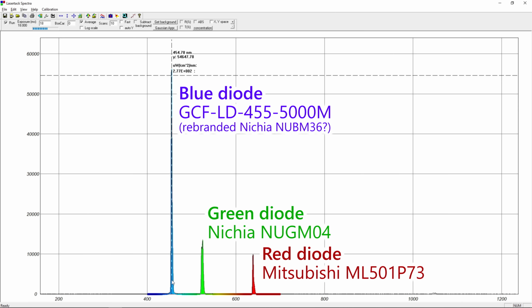But since I have no idea of how to, and could break it, I will first test the laser's wavelengths. The blue is 455 nanometers. Nice! Bluer and 26% brighter than a more indigo 445 nanometers of same power. Green is 525 nanometers and seems to have two close peaks. A hint of what's hiding inside, as we'll soon see.